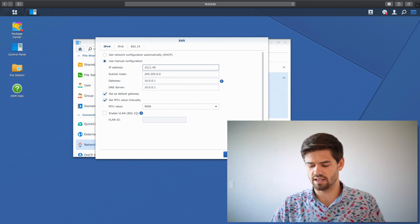We're going to go back and set up SMB, and just put in that new IP address. As we can see here, we've connected - let's make sure we've got those 10 gigabit speeds. I'm using Blackmagic Speed Test, which I love. And just like that, we are getting way over gigabit speeds, which means everything's working correctly. Really that's all we had to do to set this up - there's no need to build a crossover cable or anything like that. It just works out of the box now.